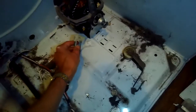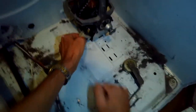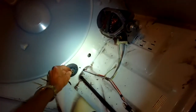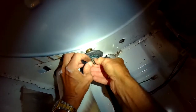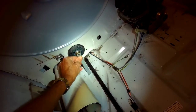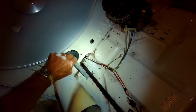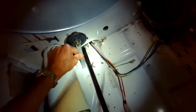If you went back forensically and asked what's the main thing that caused this dryer to fail, it was that crushed vent tube in the back. That made the lint build up, choked the motor, and caused that wheel to freeze up with too much friction. If you could go back in time and get rid of that crimped vent tube, I don't think any of this would have happened. Now it's all clean — I'm going to put the new wheel on with the little plastic clip, then put the support back in and add the screw to hold it down.